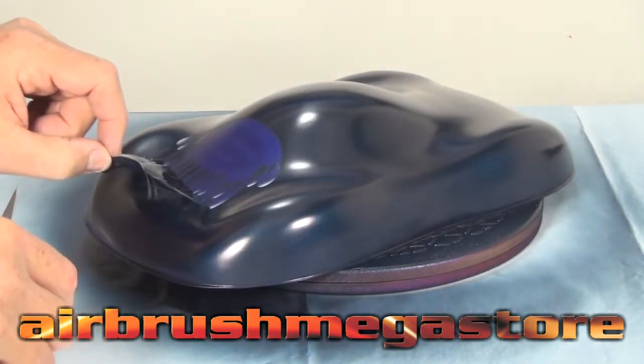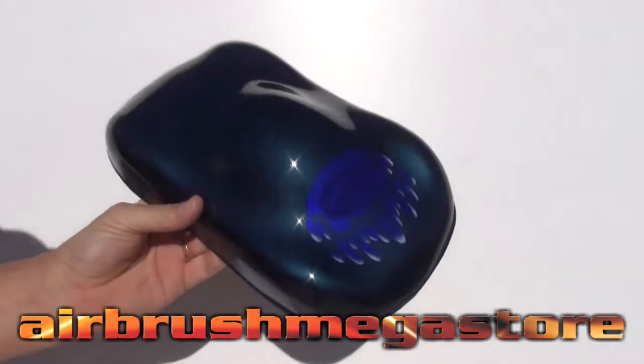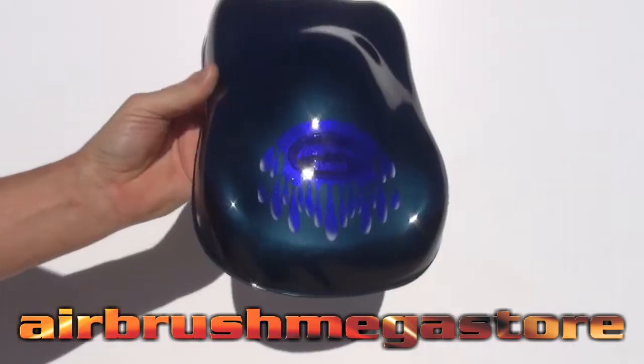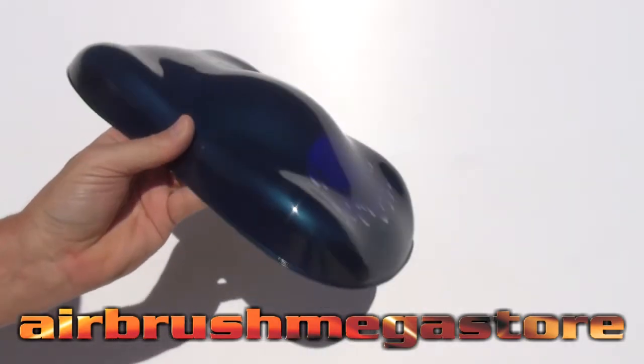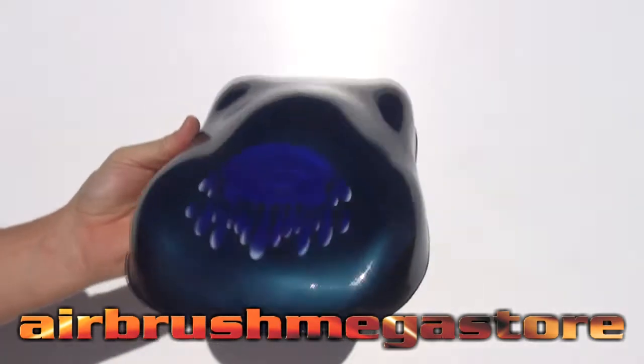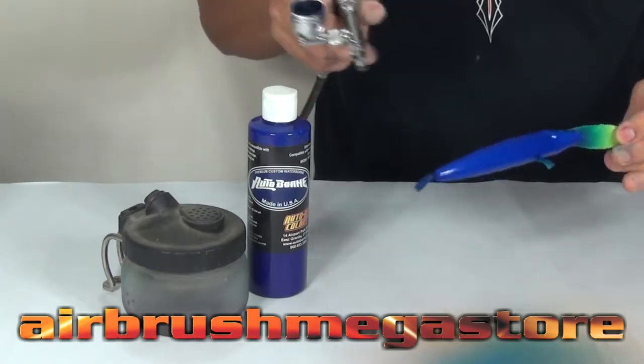In a second we'll unmask this and show you what it looks like out in the sun. For clear coats, we can use the SSR clears; if we're going into UV, we can use the 5620 clears. We can use any two-pack clear on the market, marine clears, acrylic clears, and enamel clears. You might need a test panel for acrylic and enamel just to make sure it's compatible, and as you can see, we've found almost any surface compatible.